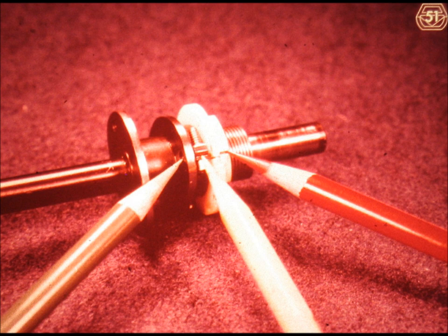We conclude that for changing the angular position of the clutch spring, we need only one tool to apply torque to the end of the spring which tends to open the spring. Be sure to review this explanation carefully. You will need it when it comes to the adjustment of the angular position of the cycle clutch spring.